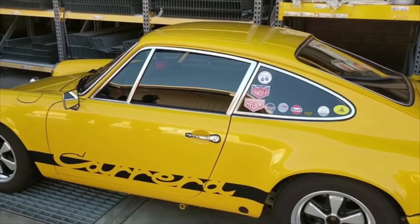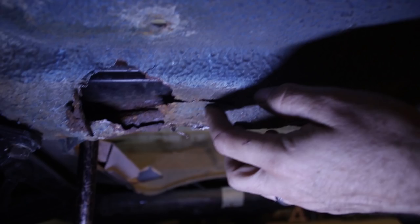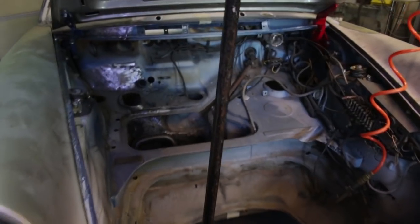My name's Tom, and this channel is all about inspiring you to build your dream car, because if I can do it, anyone can. One of the advantages of this car is it's pretty solid and rust-free. Now the front suspension pan is anything but solid. When this car was wrecked and abandoned in a field, the battery may have cracked or leaked, and once that acid gets into that hollow cavity, it is toast. It's pretty common in these cars, especially the non-galvanized ones, for that suspension pan to be worn out and rusted.